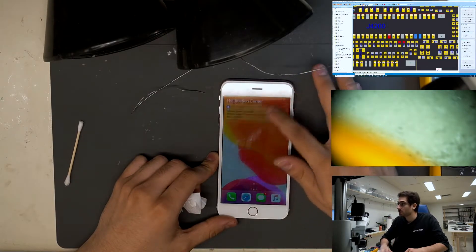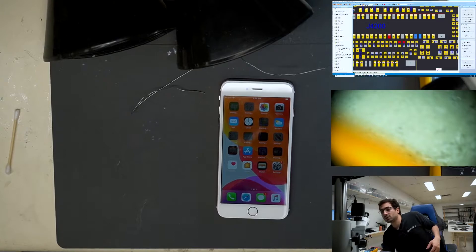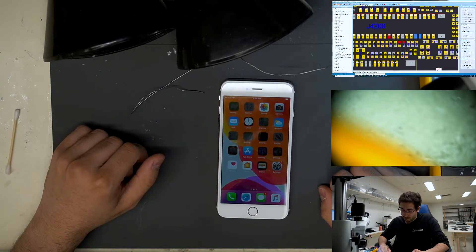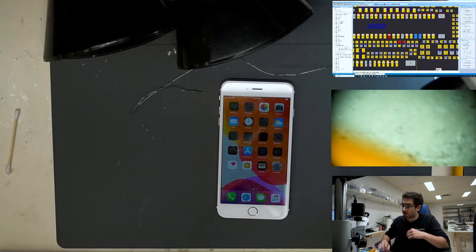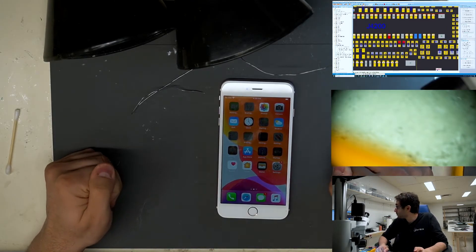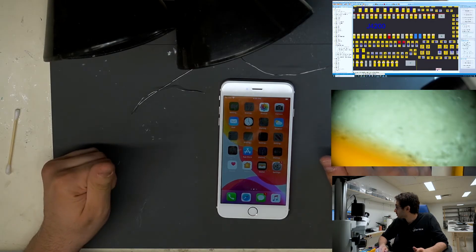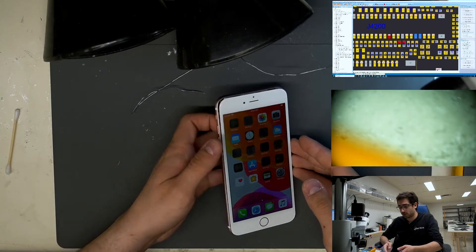Touch functions have been restored — this device is fixed. As a recap: this device came into our front-end technicians with no touch functions whatsoever. It looks like it was technician damage — usually when they try to install a screen, a component can get knocked. In this case it was filter FL4251, connected to pin 22 on J4200, which caused an open line reading on that pin. Simply reinstalling the filter solved the issue. We can get the phone assembled and back to the customer. Thanks for watching.